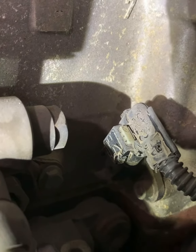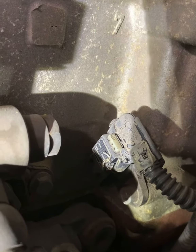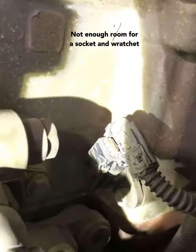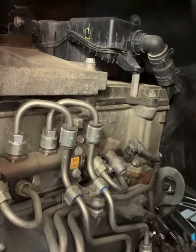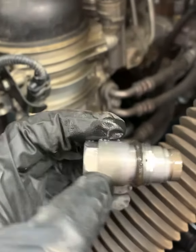We're going to take an 18 millimeter wrench and just back that off — all you've got to do is unscrew it out and screw the new one in. Remember, let the truck sit about 10 minutes and let that pressure bleed down before doing this. Here's the old one — you're not actually going to see anything wrong with it. Make sure the ring seal is on there and not stuck, then it just goes into that little threaded port. It drains out a lot of fuel too.